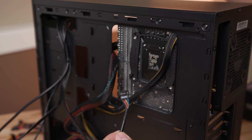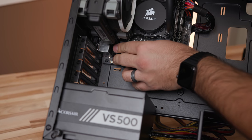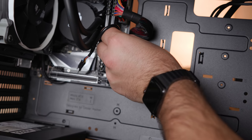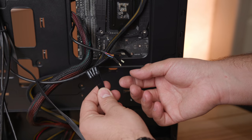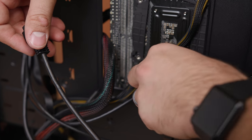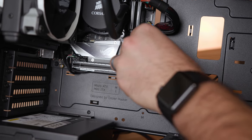Now let's route some of our other cables. Here we have the HD audio cable for the front microphone and speaker output — that connector is right back where our rear audio ports are, and it will just go in one way. This specific motherboard comes with some extensions making it a lot easier to connect your various cables. We're going to plug this little extension in and route it through to the back of the case. Now we can connect our reset switch, power switch, and LED connectors. Last, we're going to connect our USB 3 and USB 2 ports at the front of the case to the motherboard. USB 2 connects right next to the M.2 cover, and USB 3 is at the bottom left-hand side.